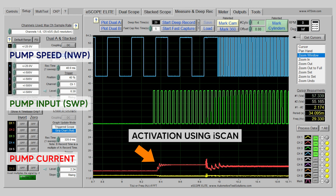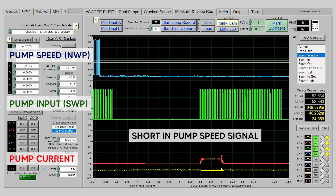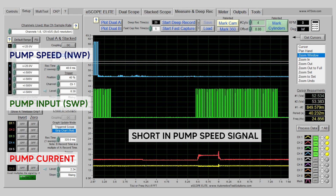For example, review the digital signals and pump current. If the pump activates and there is no current, no work is being done — this could be due to a faulty power supply, impeller, or electric motor. The pump speed circuit is monitored for faults. If a short is detected, a fault is stored. Pump drive duty begins to pulse to see if the pump speed signal will return — note the many pulses in this trace without a speed signal. Pump current shows the pump is moving, which confirms the pump can do work, but either the speed signal in the pump is faulty, the circuit to the ECM, or the ECM itself.